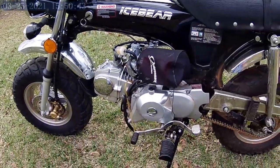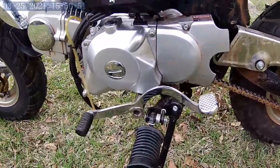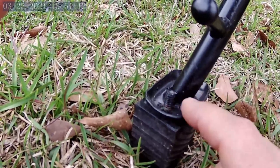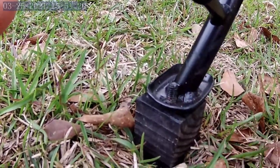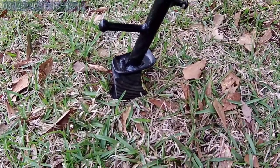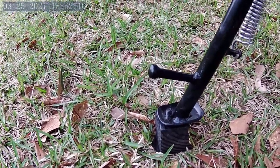Going with the larger tires, I found the stock kickstand was way too short, and I couldn't get my center stand to work with the Reggae tires — they're pretty close to the swingarm. My poor man's kickstand extension is a piece of treated 2x4. I drilled and tapped the footplate on the kickstand for a quarter-inch bolt, put Loctite on it, and sprayed black paint on it. The quarter-inch bolt has a fender washer behind it, then the wood block, and it just screws into the tapped kickstand plate with Loctite to keep it tight. The wood sandwiches the bolt so it has something to tighten against and keeps the bolt from flexing.